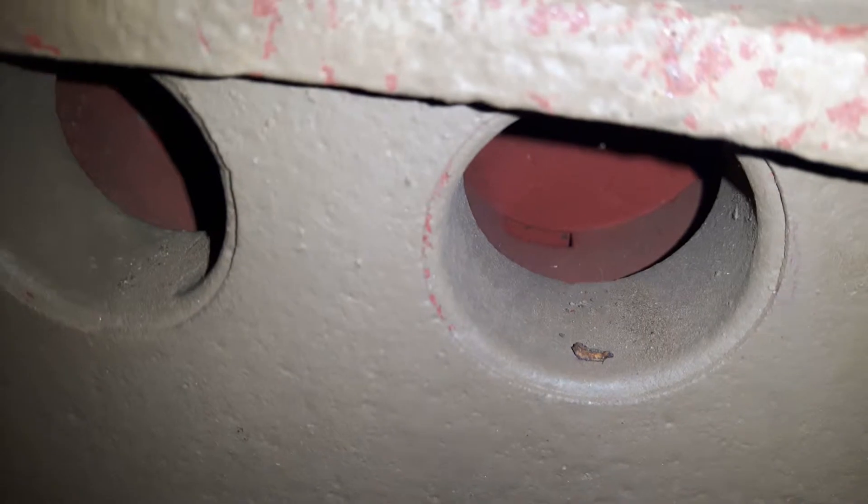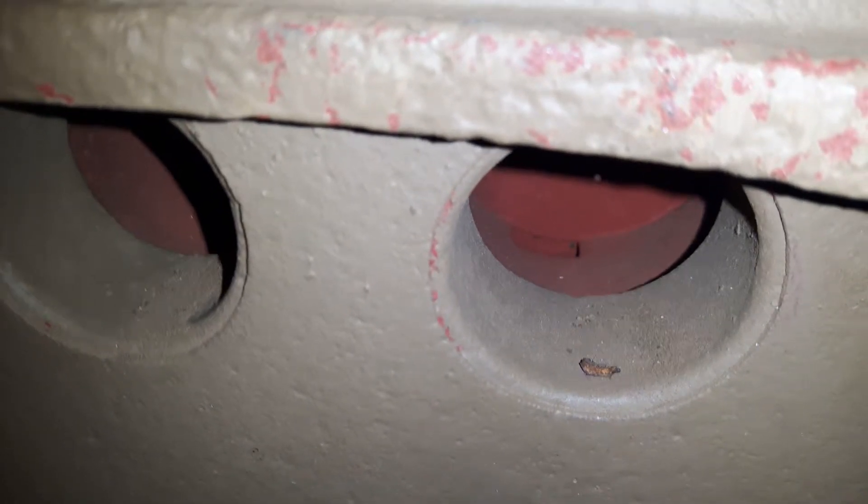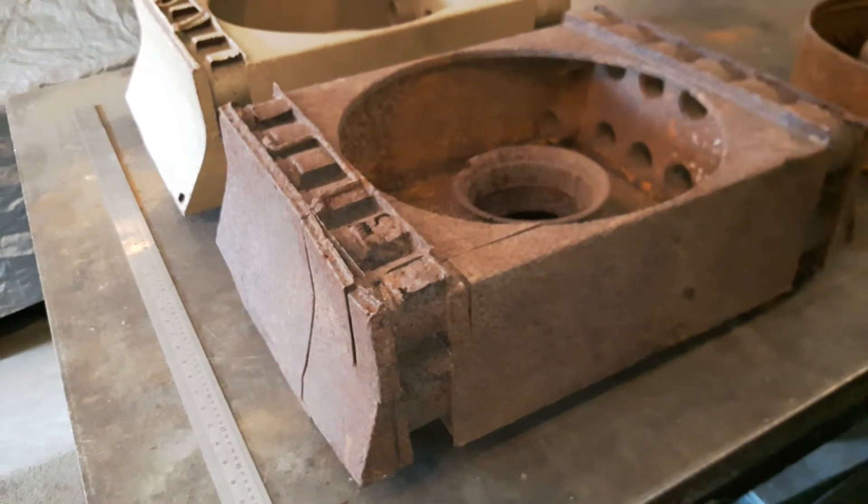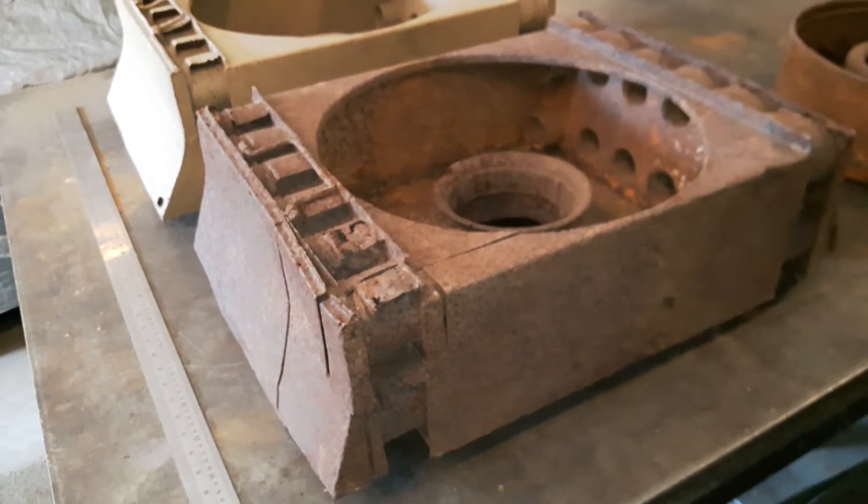As the air is spinning round it finds a small rectangular hole which has a separate extraction facility on it, so the dust is extracted cleanly away. The air itself is then drawn out of these circular ports and goes onward to the other filter parts. We'll have a quick look at this more rusty example which we've sectioned to get a better look at what's going on inside.